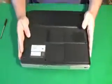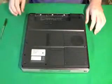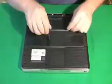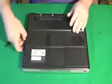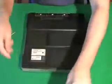The first thing I do is I pull the battery out. You don't want to have any charge in the laptop when you're working on it. Second, I'll start pulling out components one by one. Components that I can get to easily and that will be able to be removed so they're not connected to the motherboard, like the CD drive,